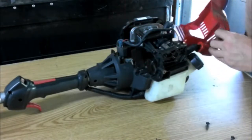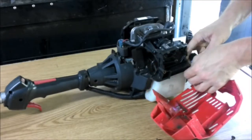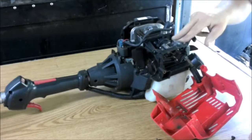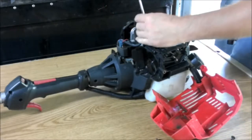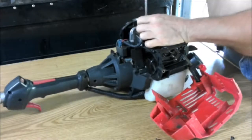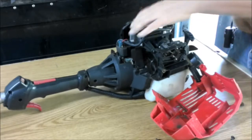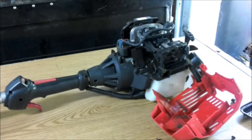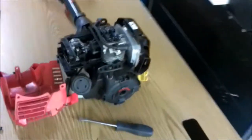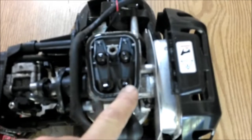Because I want to make more videos — let me know if you want me to do something like that. There's that — careful with your fuel lines, these are still limber. Dirty on the outside. But now, this is the valve cover here. There's the valve cover. Let me show you guys here. Here's the valves, and the rocker arms. These two right here are the valves, right underneath there. Here's your intake and here's your exhaust valve.